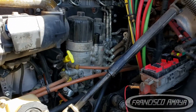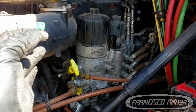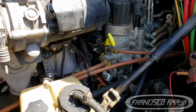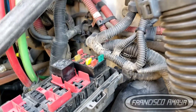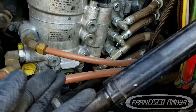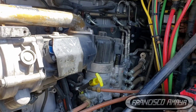It is up to you to find out. In this case, we weren't getting any power to the ECU of the truck — the MCM, as Detroit calls it — and that was the reason why I started looking around to find where the power source was completely off. This fuse was the cause of it. The problem is completely fixed now and the truck starts because we have power.